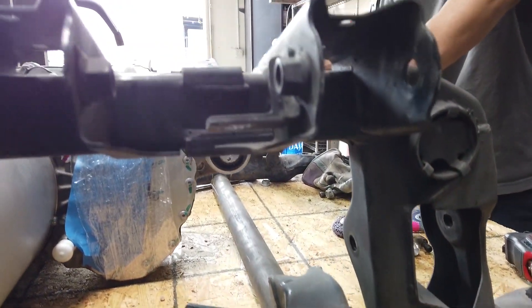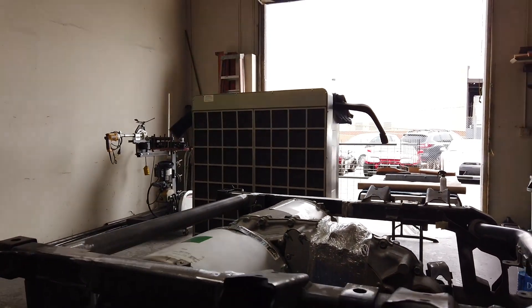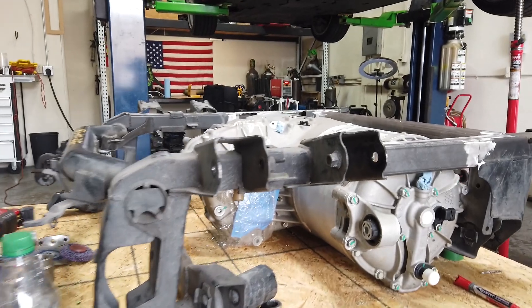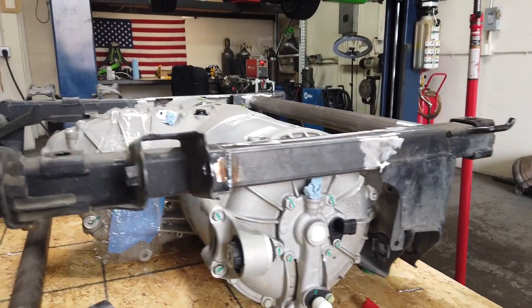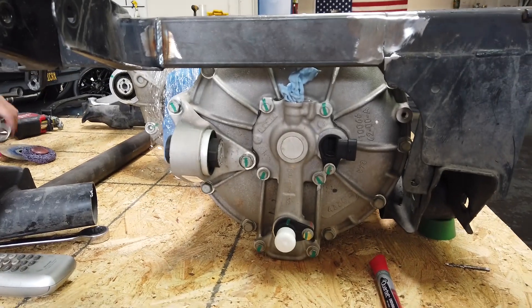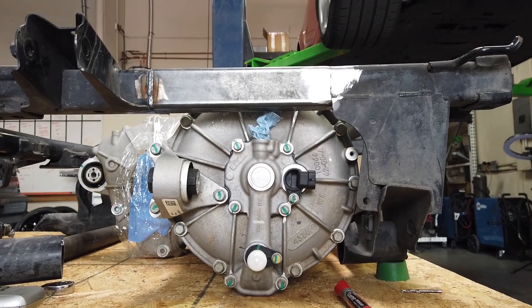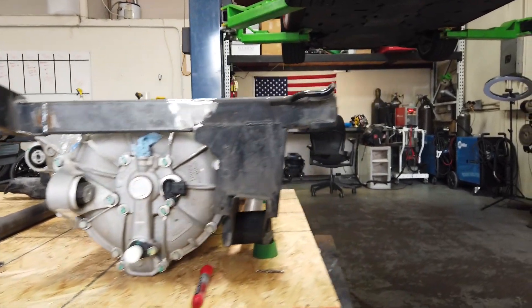That's kind of going to be the front mount, and you can tell here that this subframe has actually been extended out. What Chris did — what we decided to do — is we actually took the S2000 rear subframe and Chris extended it all the way back, basically stretched it. That gave us enough room to get the motor at a pretty good height. It's tucked in pretty well — it's going to be the lowest point on the back, but it's going to be pretty close to over the wheels, so I'm assuming it's not going to be dragging on the ground.